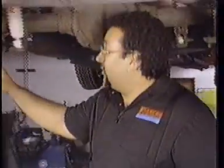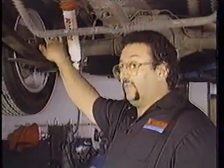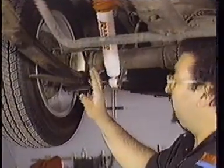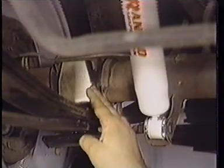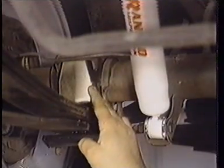Back of the Ford Ranger, the leaf spring is normally mounted on top of the housing. To lower the vehicle, it's just a simple matter of putting the leaf spring on the bottom side, utilizing the design bracket from the Rancho system.